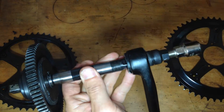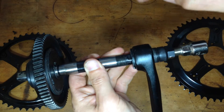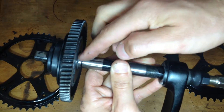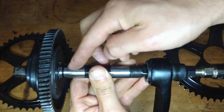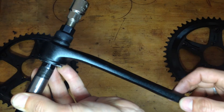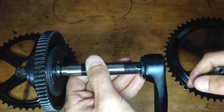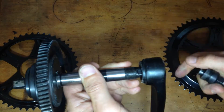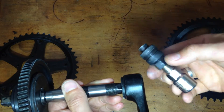This is a quite common problem that happens to a lot of bikes. The crank arm is a lightweight aluminium piece, and this is a very strong, heavy metal bar — the axle that runs inside your bottom bracket. This is where you screw the pedal. When you install this thing, there's so much pressure that you cannot remove it later, and you need an extraction tool called a crank extractor.